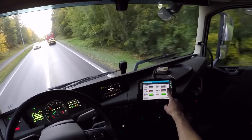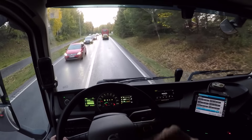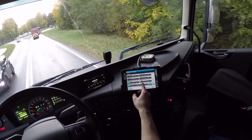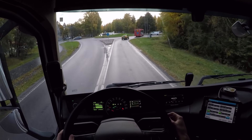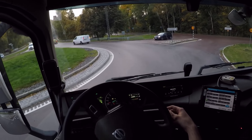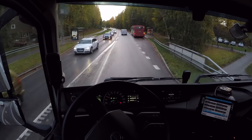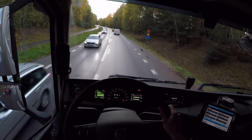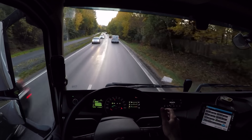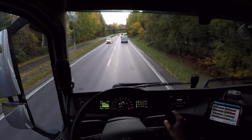The other indicators down here are the green ones — roll-on and zero gas. Roll-on is when the truck is coasting on a flat section, and zero gas is simply when I'm not using any fuel. Now it's turning green. You can put it in automatic and let it coast, or put it on cruise control, which is pretty good for fuel economy.